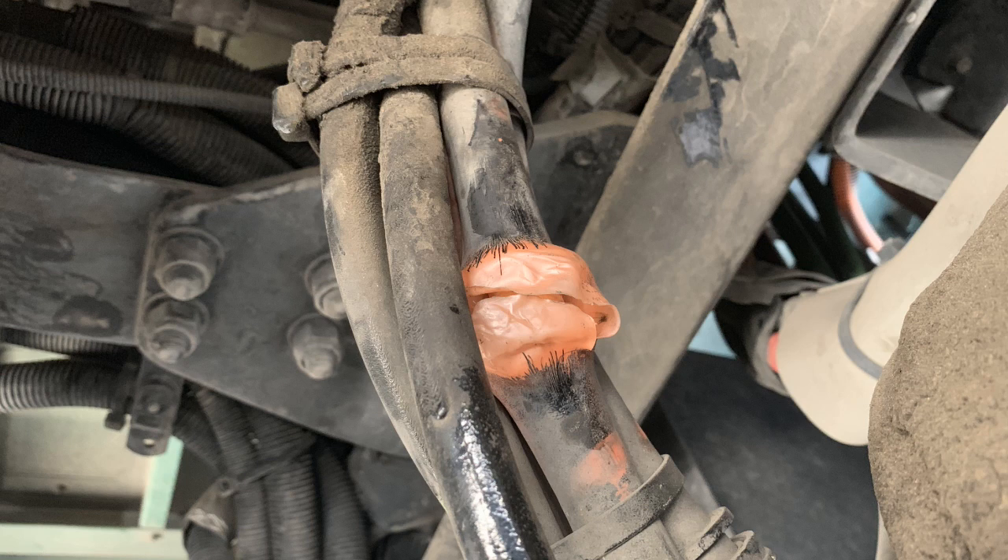So we had to bypass it a second time on the second trip. There were cops right there. When he came back, on the second trip instead of an air dryer filter, the mechanic put on an oil filter — found the same oil filter that looked like it came off an older truck. 'LF' means lube filter, so it wasn't an air dryer filter and it didn't work. I replaced the little valve and he went off, but the airlines started to bubble up.